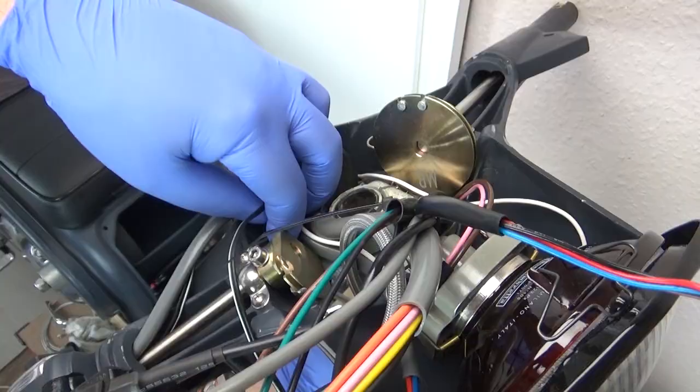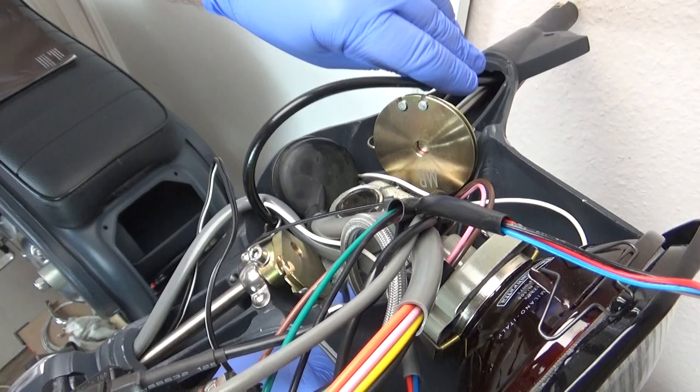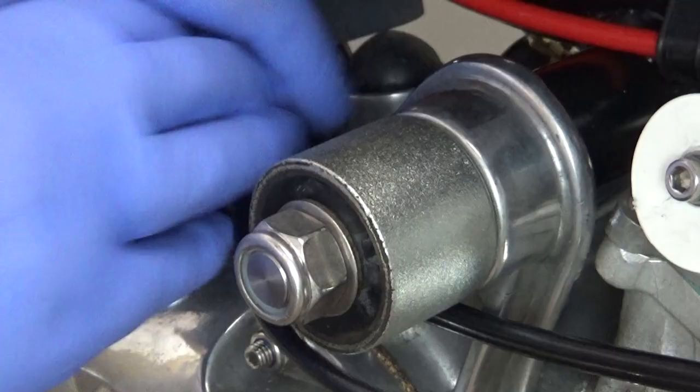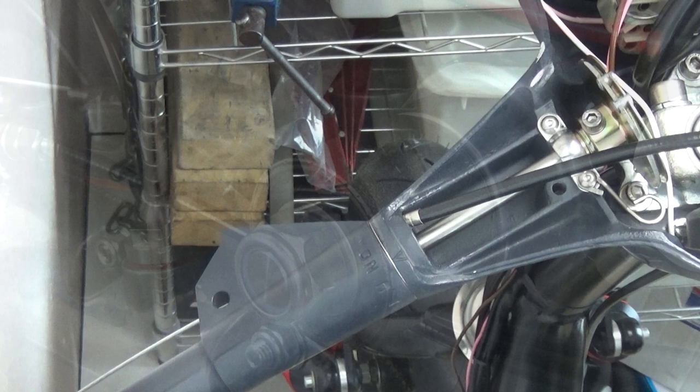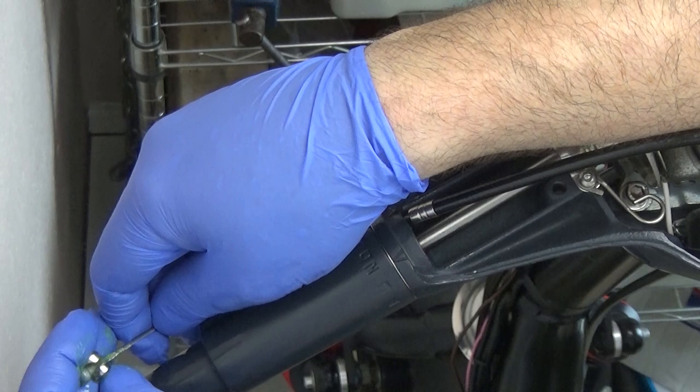Next up it's through with the clutch outer case into the socket in the gear shifter, and again along the frame, terminating into its adjuster. At the other end, and after more greasing, I can attach the inner wire to the lever and bolt that into place.